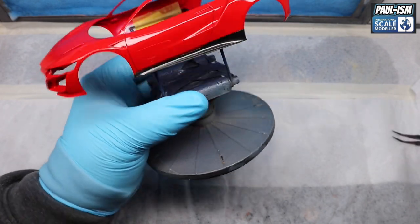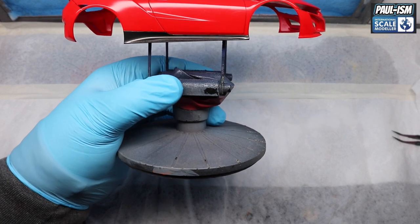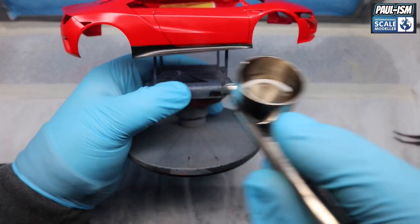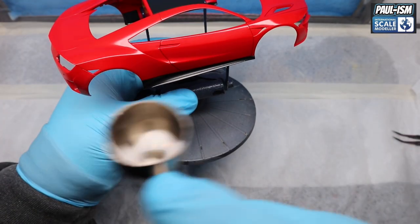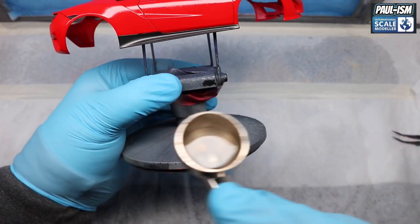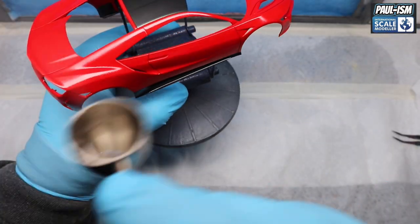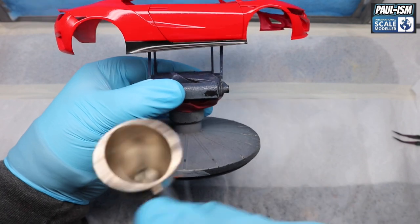Right. So, yeah, we're coming slightly wetter than we should. I was going to try a slightly wetter mix after watching a video the other day on 2K. I did intend to put it down a little bit wetter than normal, but I was literally a step away from a full wet coat, so not quite concentrating, a little bit distracted, as happens. Everyone makes mistakes, and I did come in too wet.